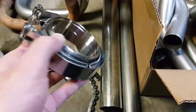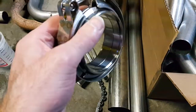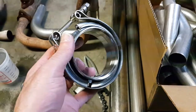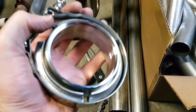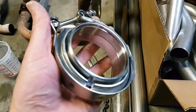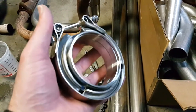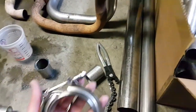As far as clamping goes, these V-clamps are the best. They have an inner ridge so they line up perfectly and they do actually seal, although they're prone to warping if you don't clamp them while you weld them. You have to clamp them down and tighten them up, then weld in that position. If you don't do that, they'll warp slightly and won't seal. You can use high-temperature silicone sealer as well — they'll seal perfectly and are easy to disassemble.